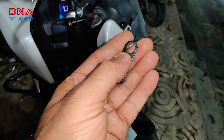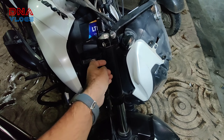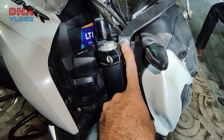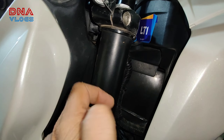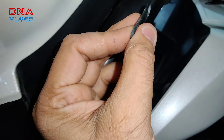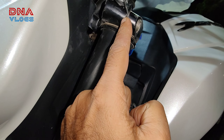Here I put a spacer of approximately 1.5 inch length. This piece actually comes from a Royal Enfield Continental 650 which is used under the clip-on handlebars. I've twisted this piece here. This length comes out from here and I've bolted it the same way as the other side. If you don't get this exact piece, you can take any other piece of this length — 1.5 inch — with two big holes. You have to remove the original piece, put this new piece in, twist it and bend it.